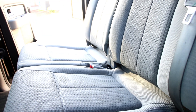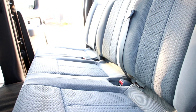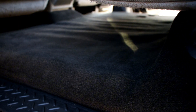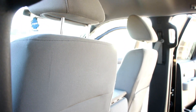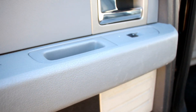There was a lot of water in the back, and after a full extraction these are the final results. There are going to be several pans just showing you the different panels you saw previously — nice and clean and sanitized — using germicidal cleaners for the hard plastics and enzyme cleaners for the carpet and seats, after a very thorough extraction to get all the mold out, while also ensuring any moisture left from the cleaning process doesn't regerminate the mold.